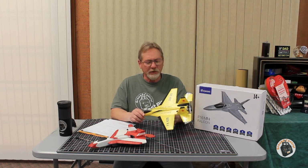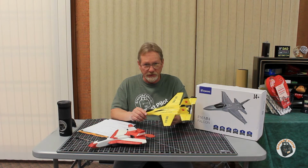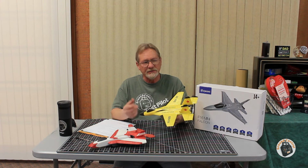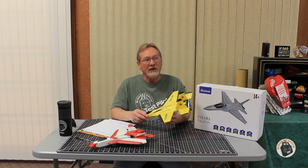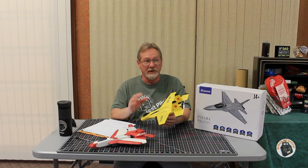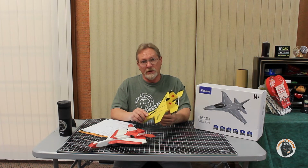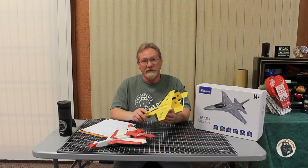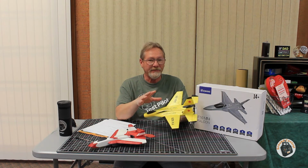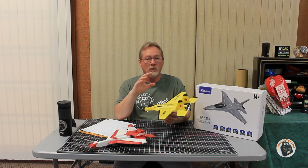But I had purchased a receiver that had a built-in 4-amp brushless speed controller, a built-in DSM2/DSMX receiver, and it was a 4-channel. It also had a 3-axis gyro built into it, with full manual mode. I would not buy a gyro brick that did not have full manual mode on it.